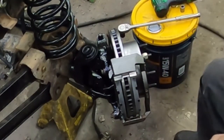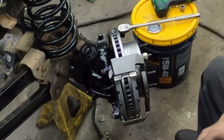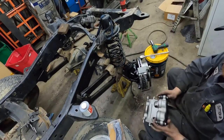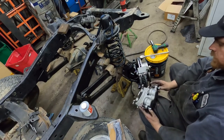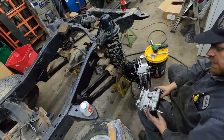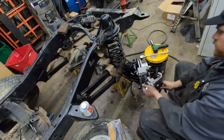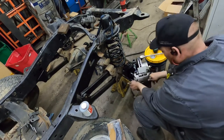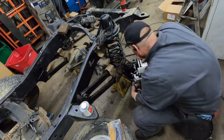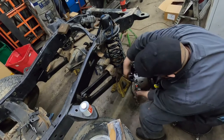Something I like to do — these are new so they're going to be good, but make sure your sliders are moving with no resistance. If there's resistance there you will have problems, and you obviously don't want that to happen, especially if you're putting all brand new brakes on your truck. Just pull out your sliders — more anti-seize.